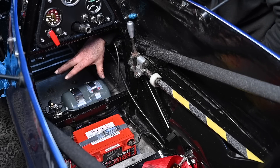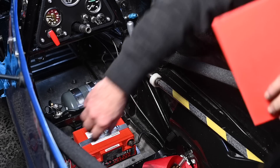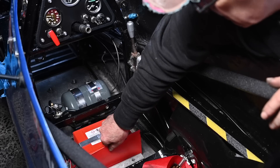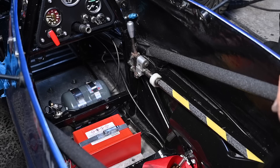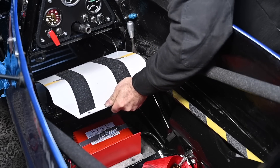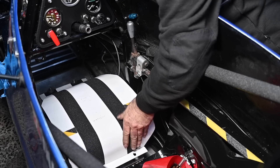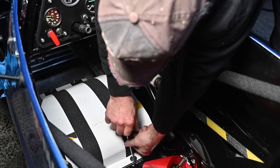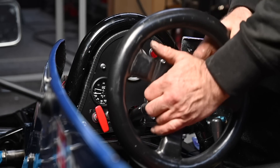The last two things I installed were the fire extinguisher and the battery. Normally when you crawl into the car, your feet are going to hit these things, and I don't like that. So I prepared a thick piece of plastic that I can put in front of the battery so it doesn't cause any shorts, and there's the panel that I'll put over it. I can bolt this down, and that's it for the front of this car at least.